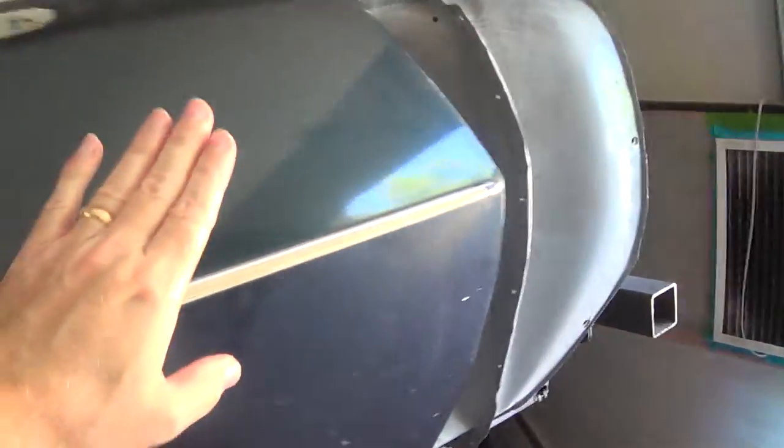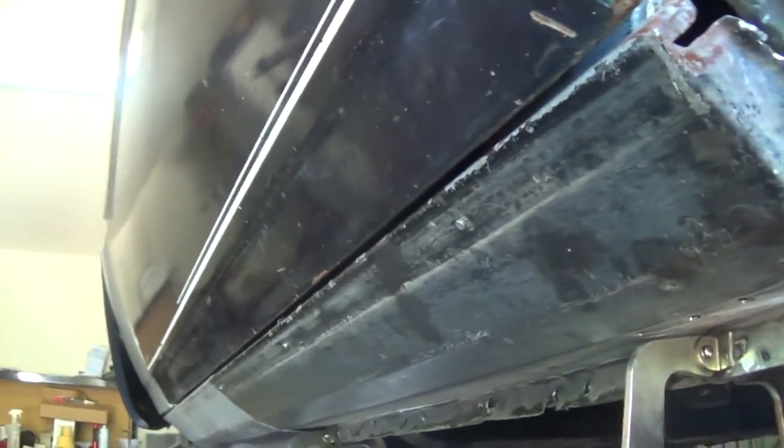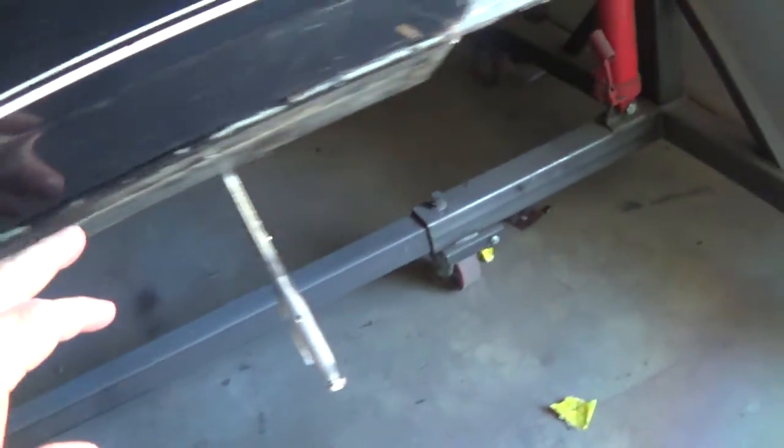I lied. I decided to take a quick check on this, and I loosened up these bolts here, and I was able to lift the door about this much. So I have a gap down there now — that actually looks about right. It does still pinch in this one spot right here. I think that rocker's bent up right there, because the rest of it looks about correct. So I'm gonna try and see if I can tap this down a little bit here to get that to line up better, and then that'll match up more with this one, which I think is correct. And now it's sticking out a bit too much here — about correct at the end. So I don't know which of those two is the right answer. This is all just kind of eyeballing here to try and get an idea of where this rocker is supposed to go.